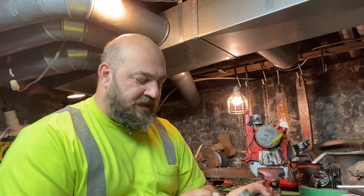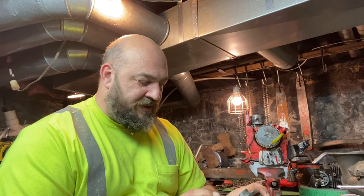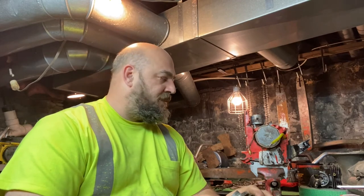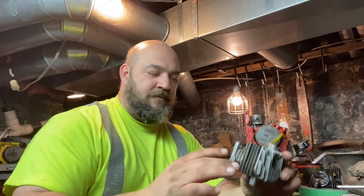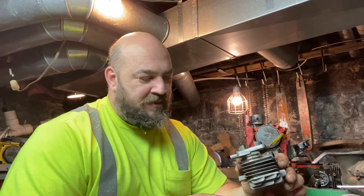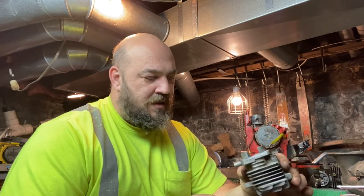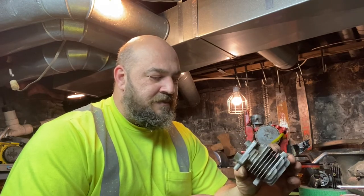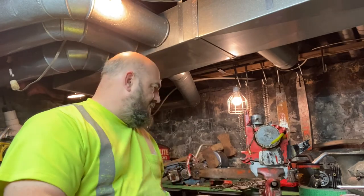This time I'm not going to put the boost ports in — I'm just going to do everything in the transfers. The reason is, whenever I first started running this saw, I'm just not happy with the fuel consumption. It's eating more than I would prefer. I'm going to try to bring it back a notch and make it a little more user-friendly. I'll keep this cylinder just in case I want to practice grinding on something — it's always good to keep your bad cylinders for practice.